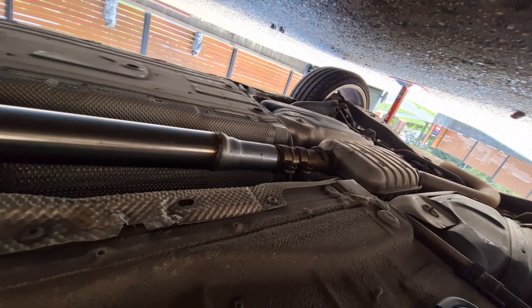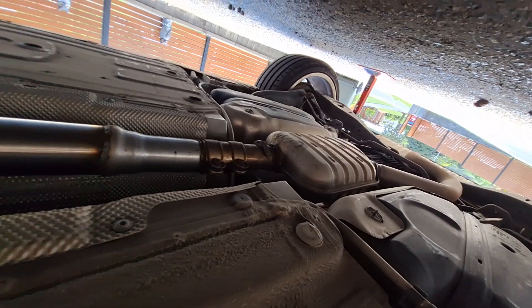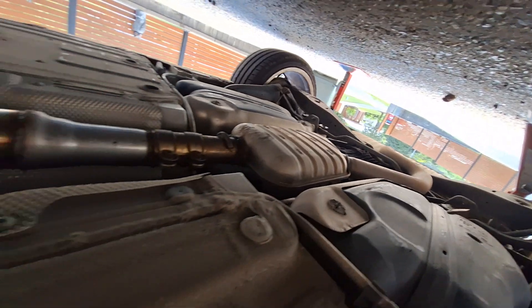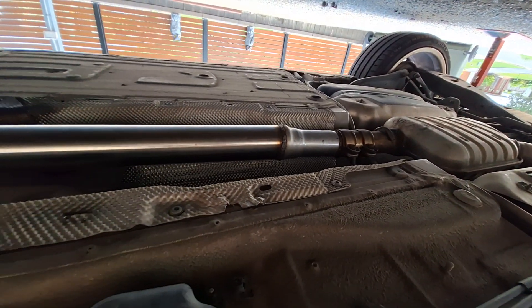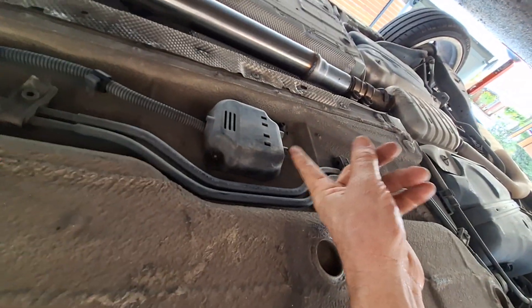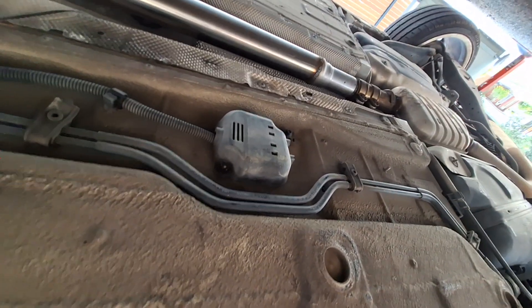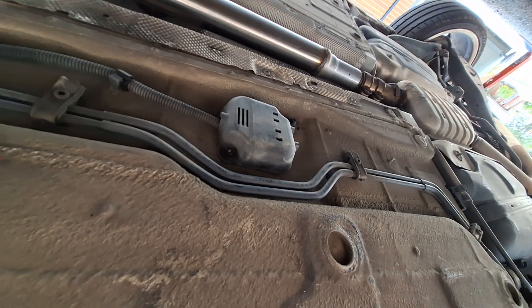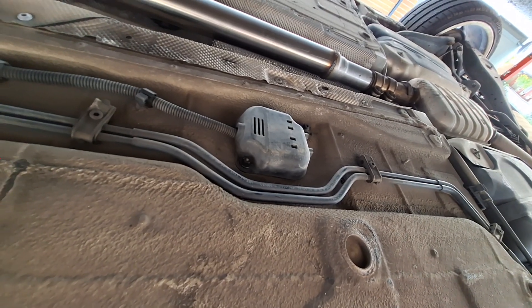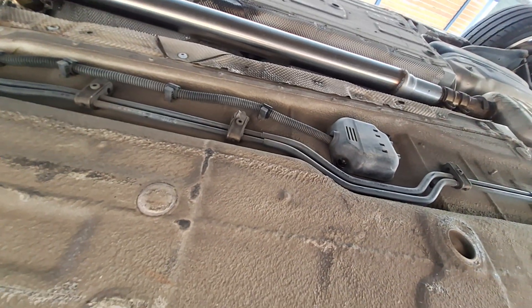It's sufficient to let me drive the car for the moment. I think I'm going to need to delete that rear muffler and mid muffler to make this car sound a bit better. The rear muffler setups I've seen are none of them three-inch inlet — they're all like 2.75. I've been able to delete the rear O2 sensors — the ones after the cats — without any critical codes. It does throw a code but it's not critical, so no check engine light.